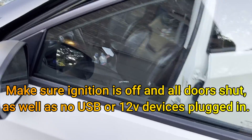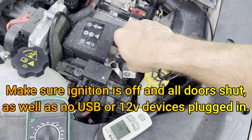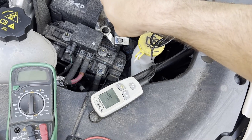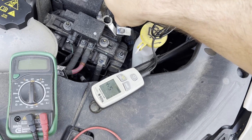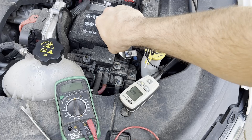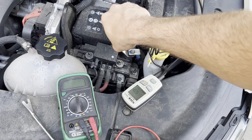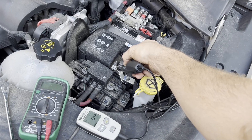Right away you can see I have eight amps — that's because the vehicle door is open and everything is still active. You need to make sure the door is shut and everything is powered down. Even after that, you want to wait a few minutes; you'll see the amperage drop as certain devices power down. In some instances it can take anywhere from 10 to 30 minutes for a vehicle to fully power down, especially once the security system sets, so you need to be patient.